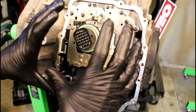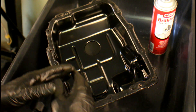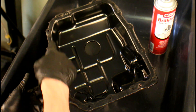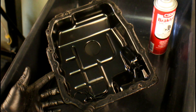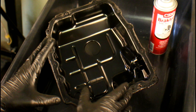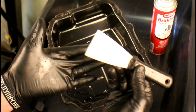Let's clean off this side cover and get it back in place. When it comes to cleaning the transmission side covers or the transmission pan, the procedure is pretty much the same. We've got stamped steel covers held in place with RTV and bolts — it's just a matter of getting the excess old RTV off. You always have some that bubbles up on the outside edge. I start with the inner edge, do the outer edge, then clean the main contact area where the bead of RTV is going to be applied. I don't feel the need to use abrasive wheels or a wire brush grinder to go down to bare metal — just cleaning all the old off and getting a nice smooth surface is all you need.